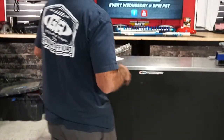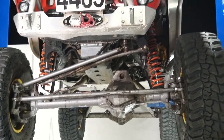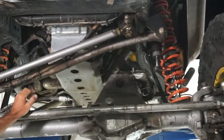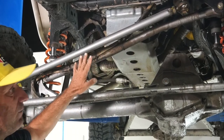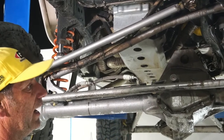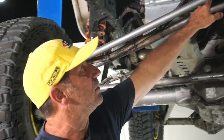Let's look at the front of the jeep. What I'm looking for is where any fluids have run down — you want to investigate where that's coming from. The next obvious thing is anything with a shiny spot on it, which means it's been rubbing. If it rubbed through the paint, it's rubbing pretty hard.